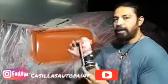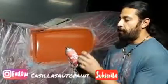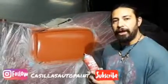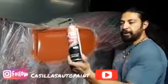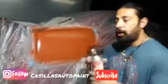The car's red, I'm using red oxide, so it takes less paint to cover. So I put about 2 coats on there, and then I'm gonna sand it with 600 wet, and then we're ready to go. And then we're ready to actually shoot what's called the base coat. So this stuff right here, guys, Transtar, works really good. 2 coats, do not pack on a whole bunch.